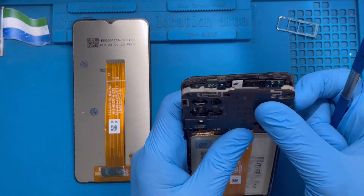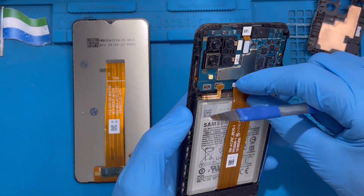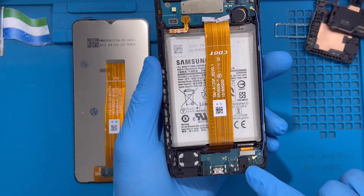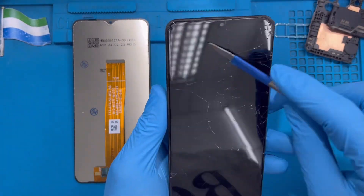Try to remove this cover — just open it like this from down here, put it to one side. Disconnect the battery, then disconnect the LCD cable from here. Open the one down here also and disconnect that LCD cable as well.